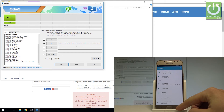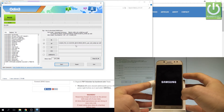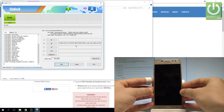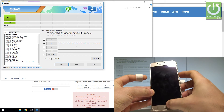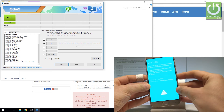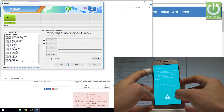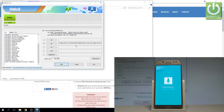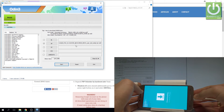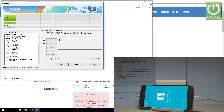Now all you have to do is turn off your device. Let me press the power key. When your device is ready, let's enter download mode — press power key, home button, and volume down. Keep holding those three keys, then release them as soon as the warning pops up, and press volume up to continue. This is the download mode. Let's connect the device one more time to the PC — excellent, the device is added in Odin.